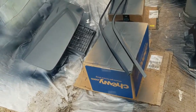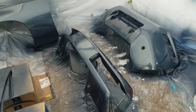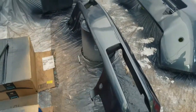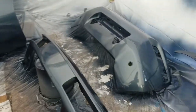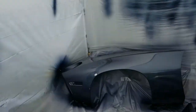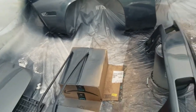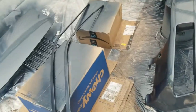The body panels I had to repaint are fresh off the gun right now. These are the ones that got damaged by the rain last time. So this time I've taken a little bit more precaution — even though it's not supposed to rain — and put plastic up, and hopefully we'll keep them safe for at least an hour or so until it flashes enough that water won't hurt it.